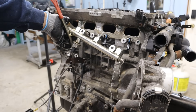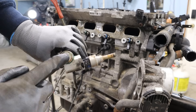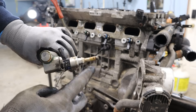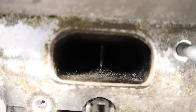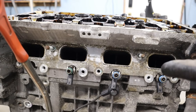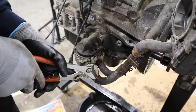Now it's time to get the direct injection rail off — 12mm bolts. Just so you know, see how rusty this hardware is? I'm not going to keep it. Usually Toyota and Honda fasteners are the best — this is probably on the same level as Subaru. There's a lot of residual gas in that rail. Three of the injectors stayed inside the head. This is what the direct injector looks like — you bring high-pressure fuel in and push it into the combustion chamber directly where the spark plug is, giving you optimal combustion, more performance, and less emissions, but at the expense of carbon buildup in the intake.